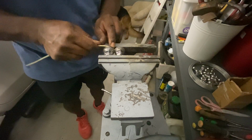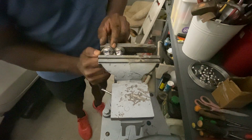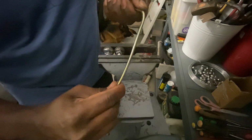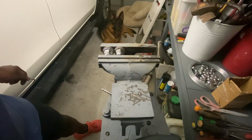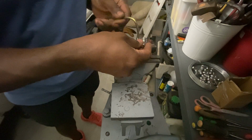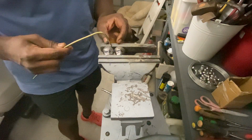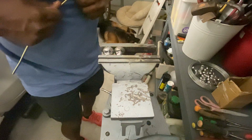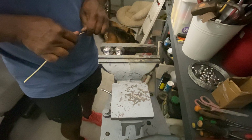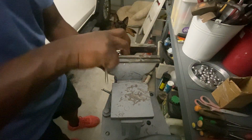It made a really beautiful curve. As you can see, look at that. So you can even put two smaller sockets like something like that, and then do an even tighter radius. But that's probably about 25 mil diameter on that, probably 12 mil radius, and it seems to work quite well. Yeah, so I just thought I'd show you that little trick I did as well.